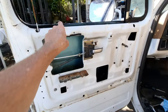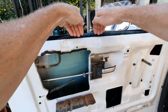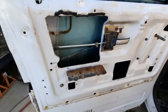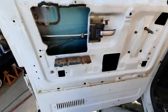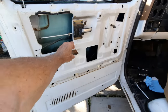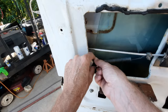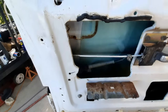I'm going to wash all the grease off my hands so I'm not getting any grease on that white paint. I greased up these little spots where the clamps go in - the reason it was so hard to get off in the beginning was the window was jammed stuck up. So we got a spring, we got all the rails lubricated with grease. That metallic sound only happens when I shut the door - not a big deal. I went ahead and stopped that little spring sound too: I cut a little vacuum line, put a slit in it, put it against the door, and I have some velcro on the spring to isolate it as well.